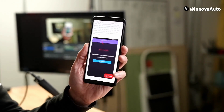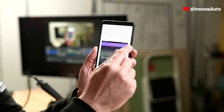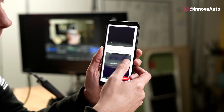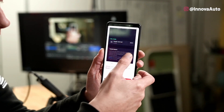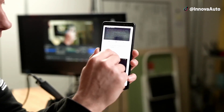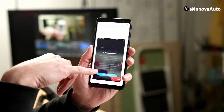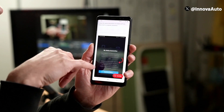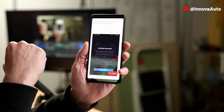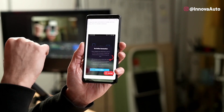In our article, we have a dongle hooked up in an area with no services — I have it in airplane mode just to show you. After it finds the scan tool and the dongle pairs, since there's no online connection, it gives you a brief description. Basically, you can get ECM, PCM, TCM scanning, and live data still — the essentials. But all the advanced features the 430 has, like ABS and SRS, won't be supported when you have that offline connection.